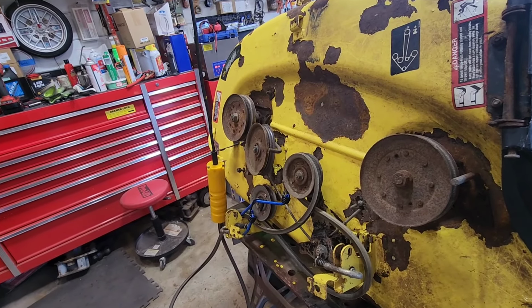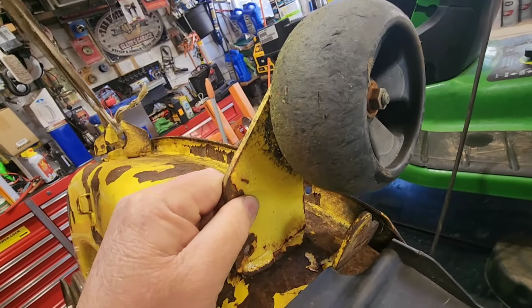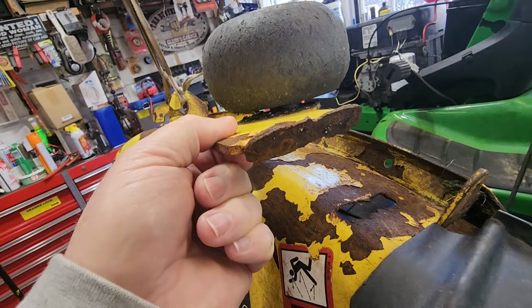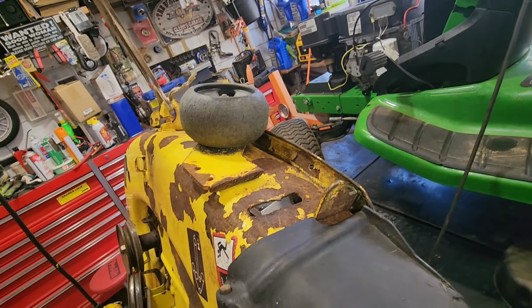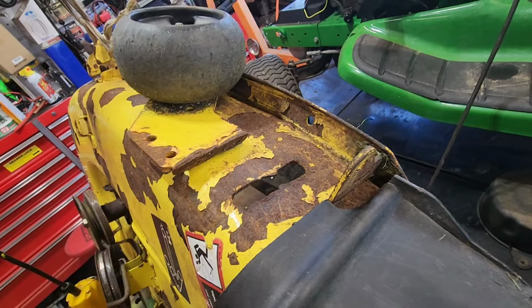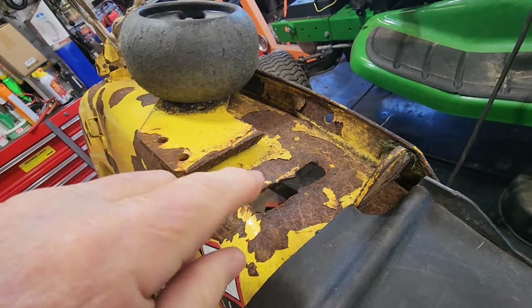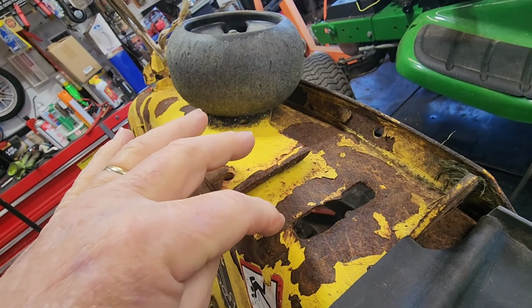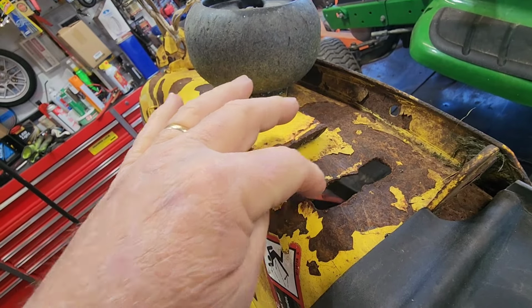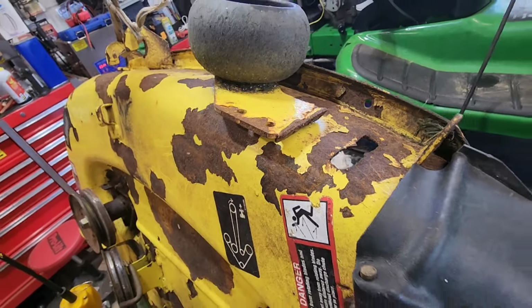I reached out to a potential sponsor on a pair of blades, but then I put a pair of them in my shopping cart in case that falls through. This deck wheel here came off of here, and what's left of it fits the hole. So that's good. The anti-scalp wheel's in good condition. We can reuse that. So what I'll do here is we'll grind this out on the inside, weld a piece of 1/8 inch on the inside, clean up this hole, pound that back straight again, and get all this metal cleaned up. Clean this up on this end, and then re-weld it not only to the 1/8 inch steel on the inside, but to the deck on the outside. So a nice, big, heavy, hot, wide weld will make that in great condition.